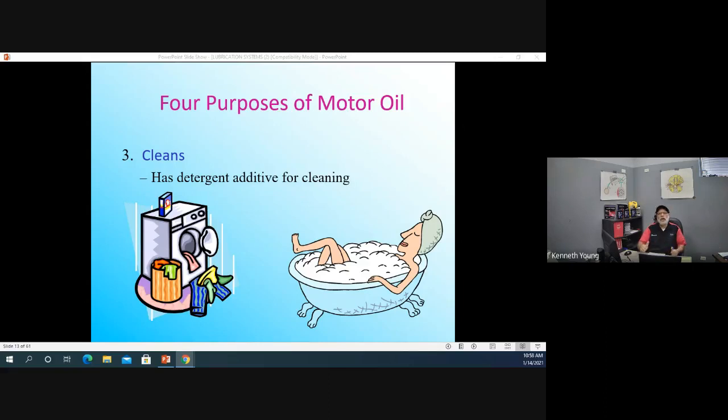Hey, guys, the best way to know the proper oil change intervals depends on what your computer says. Think about it. If your computer is watching what the engine is doing, it knows how many times you started cold. It knows if you're an Uber driver, so you like to let your car idle all the time. It knows how much stop and start you do. So the intervals on newer cars are based on driving habits. The best way to know when to change your oil is based on driving habits, and the computer monitoring system is going to tell us that. And I would suspect, although I'm not sure, depending on the year of your car, half the students in the room have an oil change monitor on their car where it pops up on their dash.